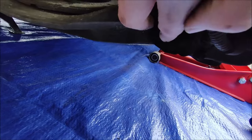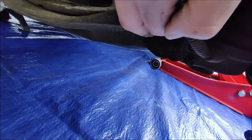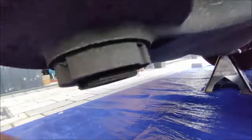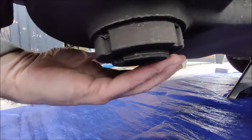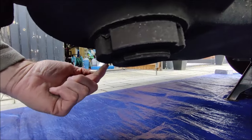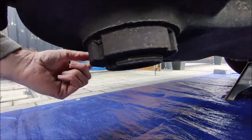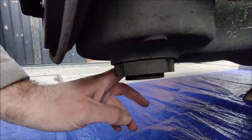At the bottom you have a back plate with two bolts, behind which is a spring. The spring pushes against the dog tooth, which goes into this hub mechanism here — this is the pivot point. If the dog tooth is pushed in, the hub can't rotate. If the dog tooth is pulled out, the actuator can rotate the hub.